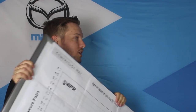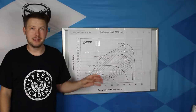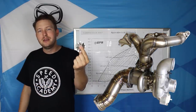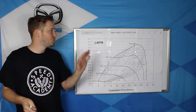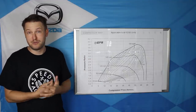The main focus today is about compressor efficiency, but to understand compressor efficiency we've got to take a deep dive on how to read a compressor map. What a compressor map does is show the flow capabilities and efficiency for a given compressor. Being able to read one is very important when choosing the right size turbocharger for your engine. The compressor map only looks at the efficiency of the compressor — it doesn't account for turbine size or A/R. For example, two turbos with the same compressor wheel but different turbines would use the same map but act differently.